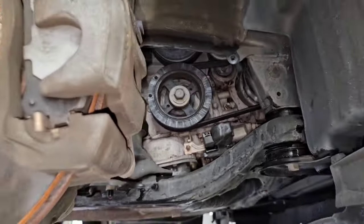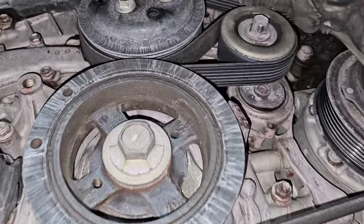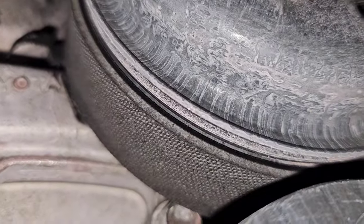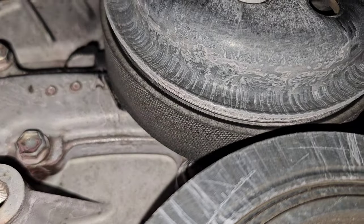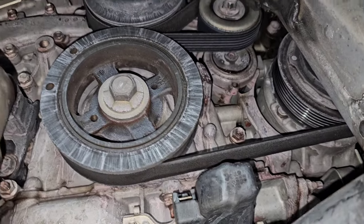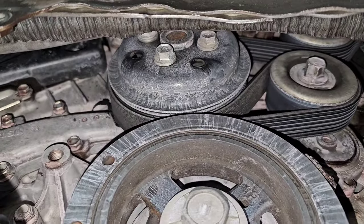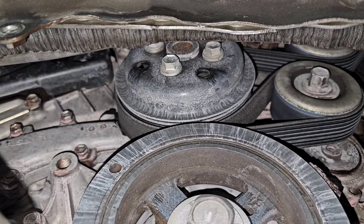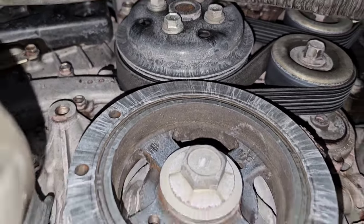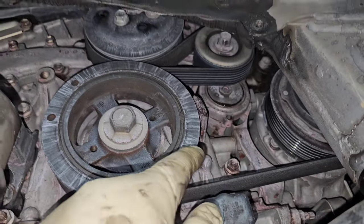So up in the air — I obviously pulled the front wheel off on this side. There's a shield that goes here; I pulled that off. As you can see, the belt has actually jumped a tooth or a cog on the pulley there, and you can see it's actually rubbing into the pump itself. You can see the staining everywhere from the pump. Right now it's the easiest time to break those water pump pulley bolts free — those 12s. It's Toyota. We're also going to be putting a new belt on this, that's for darn certain.